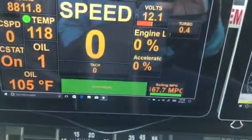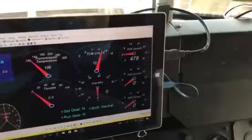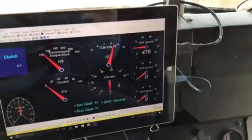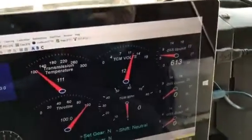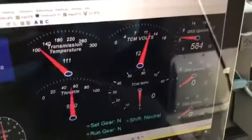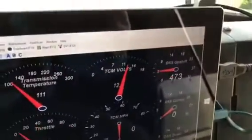My road speed error — hopefully that doesn't stay because that messes with the speedometer. I also don't know if that J1939 link is going to send speed information. If it does, I may be able to avoid the speed link altogether. However, the fact that I set a code over there means I probably can't avoid the speed sensor errors — it's probably always going to get speed from that sensor.